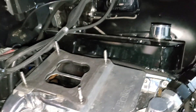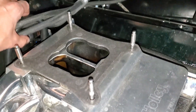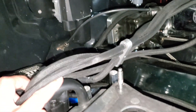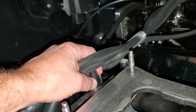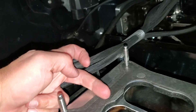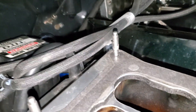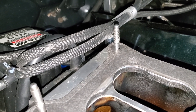I took the carb off and stuck my bore scope down here. This is the runner that goes to number seven, and right here I think is the culprit - I'll show you a couple of pics. Check this picture out - this is the PCV valve hose, so this is crankcase ventilation. I don't know why it's plumbed over here. I think the guy who originally built the motor did it and I kept it there. It should be plugged into the carburetor so it gets dispersed amongst all the cylinders. And check out this picture - this is the number seven valve. Look how caked that is. I think it's from the oil coming from the PCV valve from that other picture. That's the root cause, my friends.